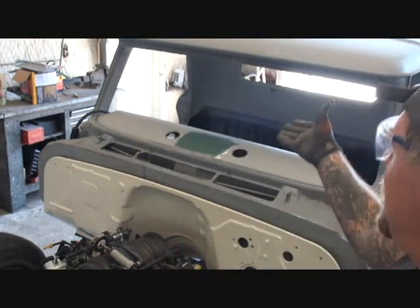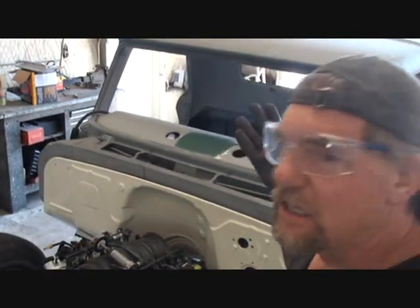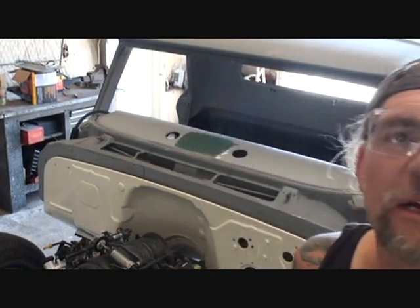This is Pete, my friend Pete, showing you that patch paneling the inside of your car is easier than you thought. Now if you happen to own a TIG welder or know somebody that has one, you would go back and TIG weld the whole thing up — but it's not necessary. What we have done will last a lifetime of the owner owning this vehicle, and past that.